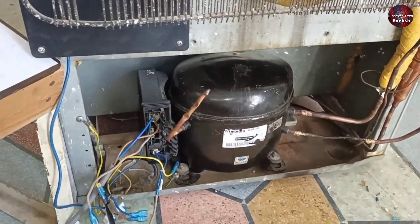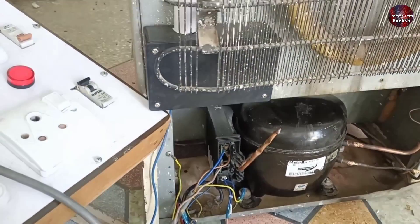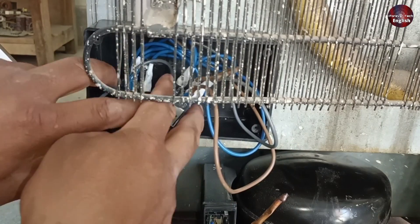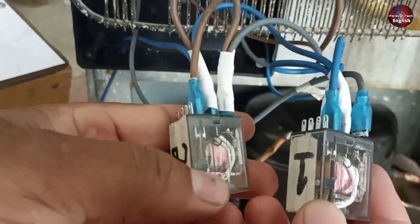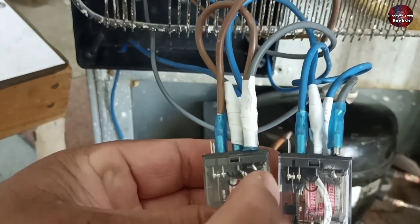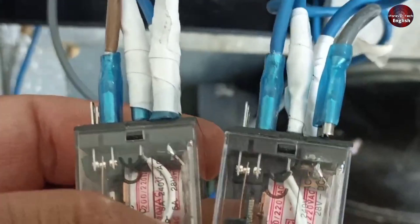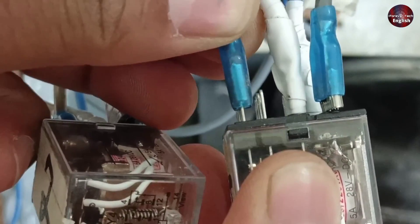I made a new wiring connection to the thermostat. Let's check them one by one. I am going to check the connection of these relays first — this is the number one relay and the other is the number two relay. So I have made a mistake in the connections of the relay. The connection in the number one relay, which is attached to the heater, should have been attached to the wire that is normally on.